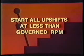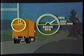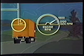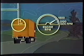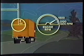With a little practice, progressive shifting will become natural to you, and the extra effort required to learn it will pay off in fuel cost savings. Another fuel-saving technique is to operate the engine at less than governed RPM while in the top gear. This enables you to drive at cruising speeds in the more efficient fuel range of the engine, while still having reserve power to bring the engine back up to governed RPM if needed.